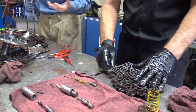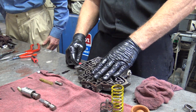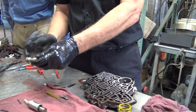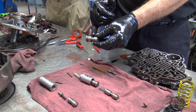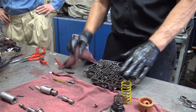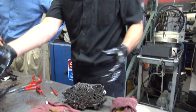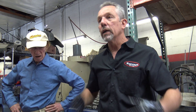Are they in good condition, these valves? Yeah, they seem to be all right. But that should have just fallen out freely. When you see this kind of witnessing — where you can see where it was riding — it's always good to polish it, because any kind of burr or grit will restrict its movement and cause shifting problems. And when you start to reduce pressures when you're applying these things under higher pressure, they're going to start slipping and letting go, and that just makes everything overheat and fail.